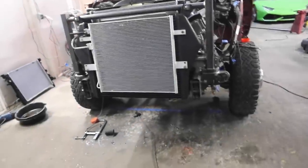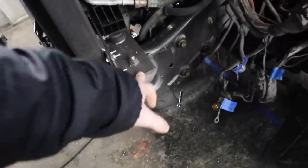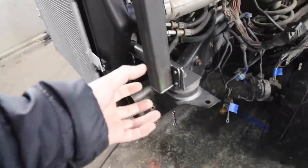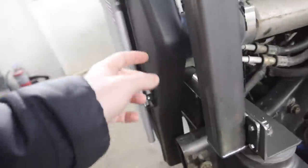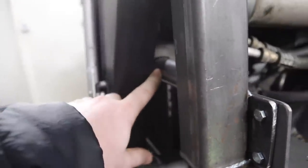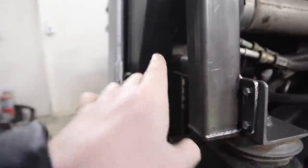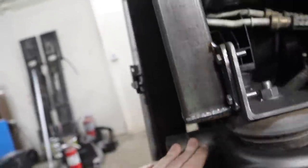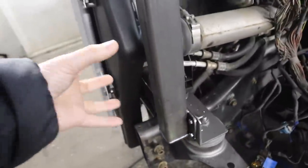It's a good looking package, Oscar. Heard that one before? Yep. This is really slick. Oscar built some isolated frame mount uprights that are coming off of the body, and then the intercooler, you can kind of see right there how it hooks around this 1 to 1.5 inch bar. So we shot that thing, and that lives in this air gap between intercooler and radiator. So that's where the intercooler supports its weight.